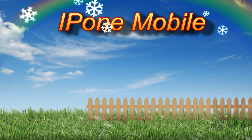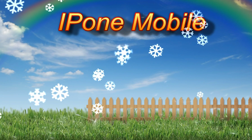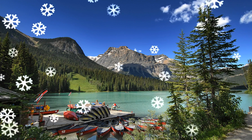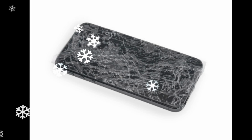iPhone 6s battery replacement: if your display glass is cracked, keep further breakage contained and prevent harm during your repair by taping the glass. Lay overlapping strips of clear packing tape over the iPhone display until the whole display is covered.